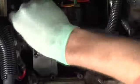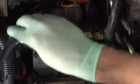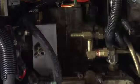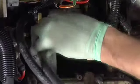Before inserting the bracket that holds the diesel pump, the diesel filter, and the fuel control valves, A and B, it's a good idea to begin plumbing your fuel connections while you still have access to the diesel lines and the manifold. Follow the fuel plumbing diagram included in your manual. Don't forget to add and tighten the hose clamps to the rubber line.